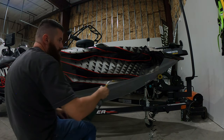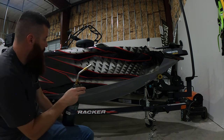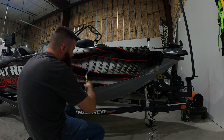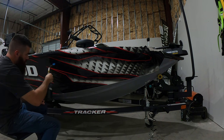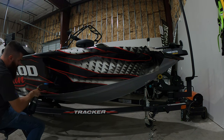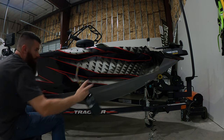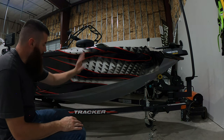I'm going to give this just a little bit of heat here. Now that we've got it flattened out where we like it, a lot of times I'll start at the top and work my way down, and then come back up. That lets the top part start shrinking a little bit, and then the heat from the bottom is going to rise up and then really start shrinking that wrap back up. We're going to give that a couple seconds — it's going to flatten up — then we're going to start working that air out through the top and out through the bottom.